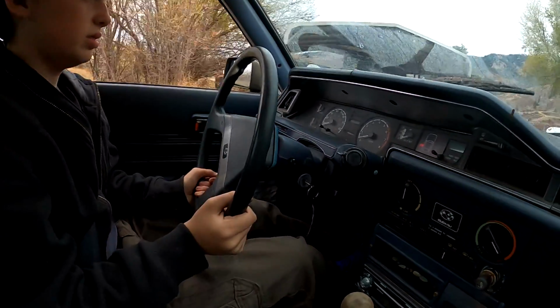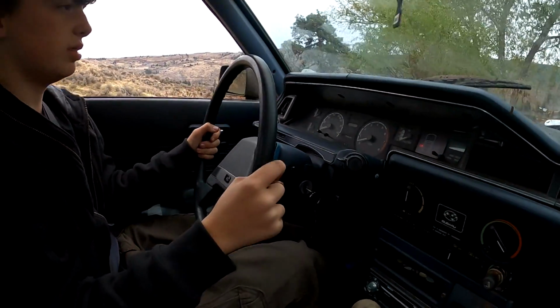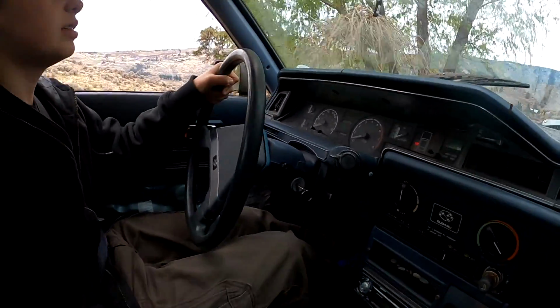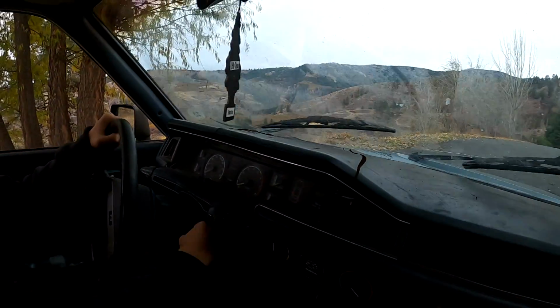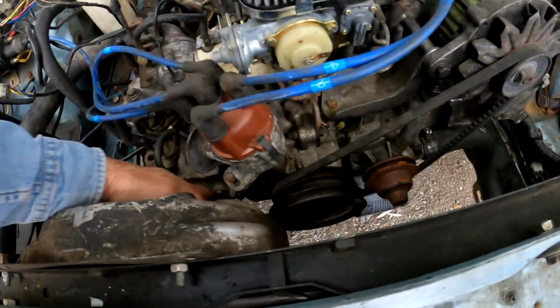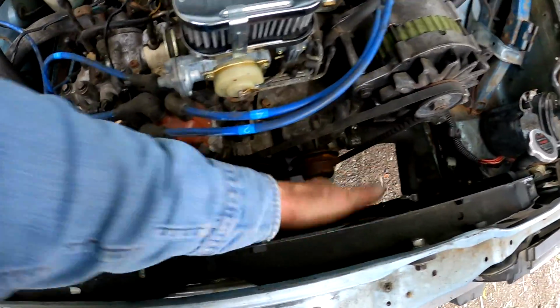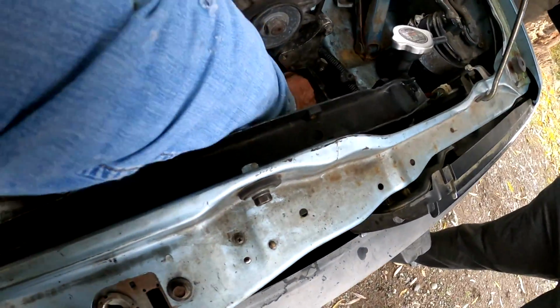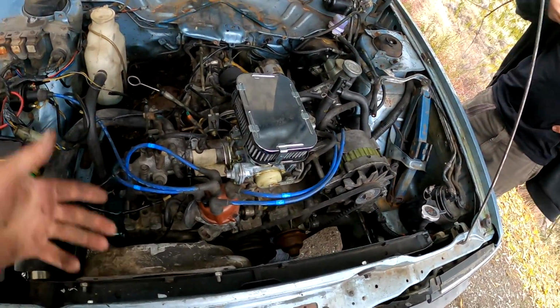Yeah, it's just getting warm. I'll show you why. The radiator's in, yeah, but I don't know if that temp sensor's working. Just shut it off right here. This is good. All right, Noah, maiden voyage. Maiden voyage, pretty good. That goes into the breather, on the old breather. There's a temp sensor right here in the radiator, Noah. It's hooked up, but I don't know that it's working. It's not hot yet. So when it gets up to like 180 or something, then it kicks the fan on. All right. But we can bypass that.